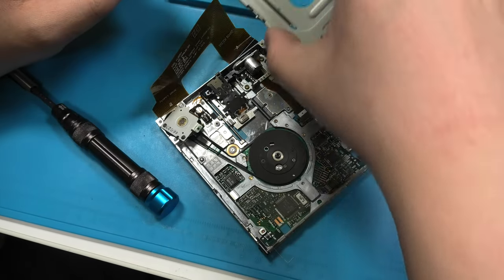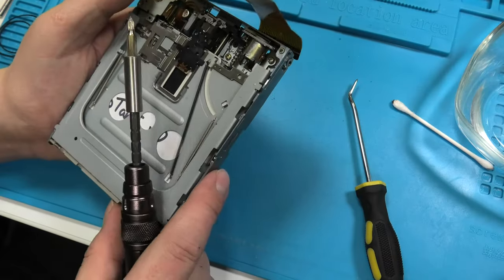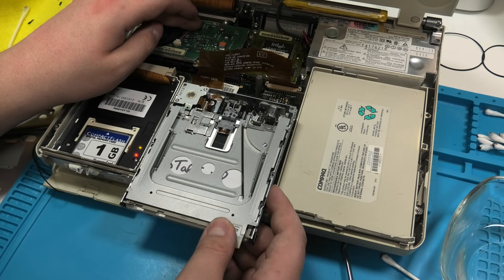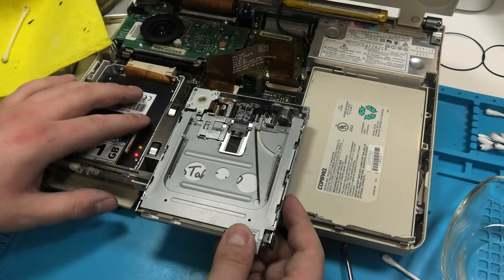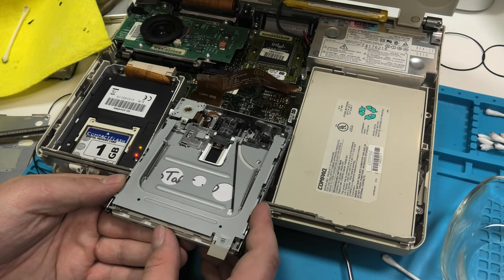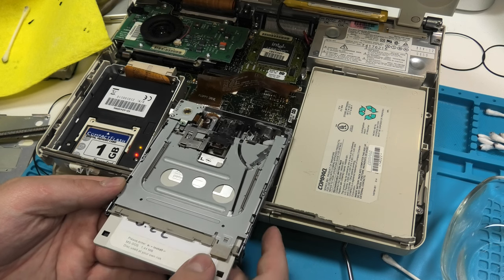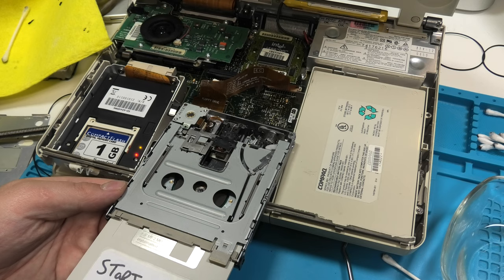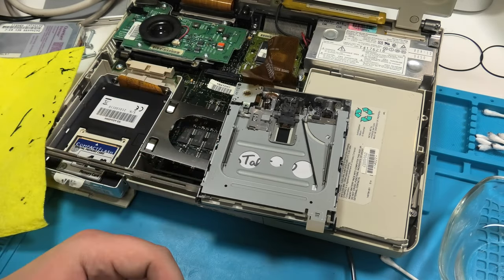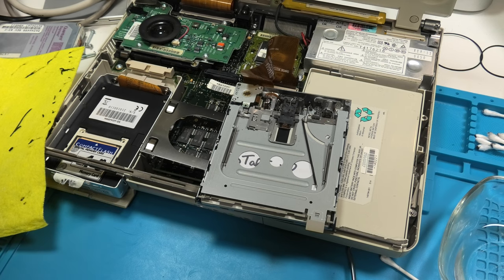Then I reassembled the drive and connected it to the laptop. It appears to spin up for a second every time but the laptop doesn't want to read it. I was surprised it wasn't too hard replacing a belt in one of these small disk drives — I expected it to be more difficult. I have more vintage laptops that require belt replacement. I replaced the first belt; I don't know what the results will be, but we have three more drives to service and a whole bunch of other problems.